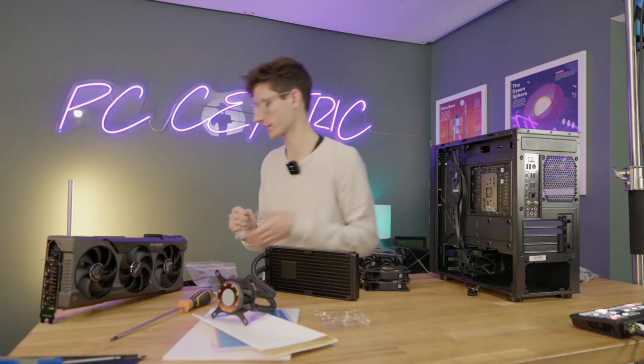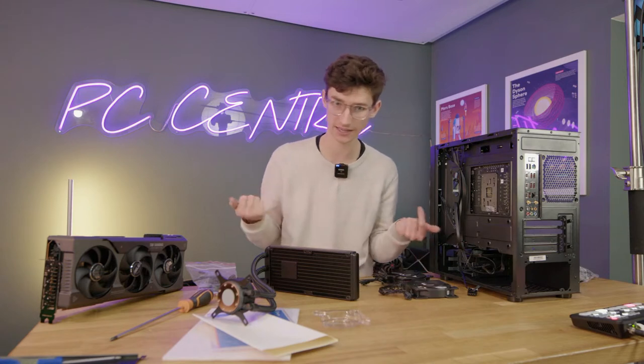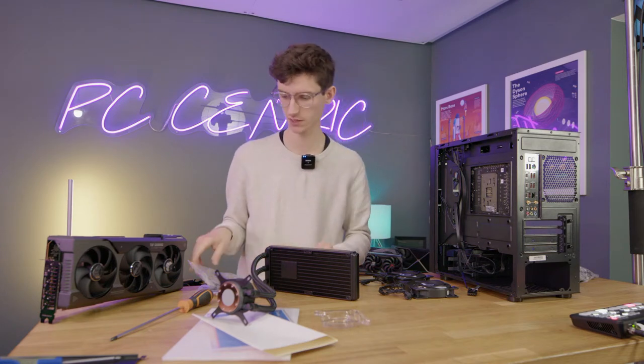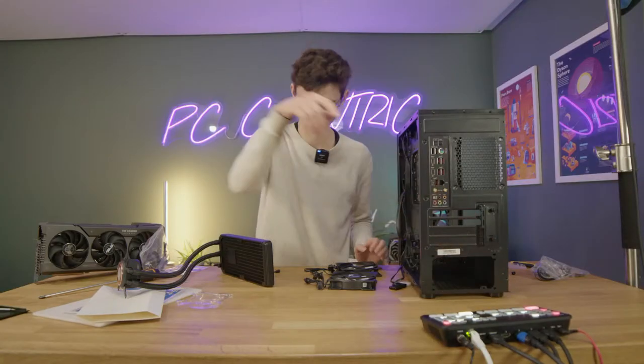I had an early access one of those. It was an H100i Elite Capellix, and it did that. Had to go back. I don't know if it's new or not, but yeah, that could be an overheating problem. So if you have a different heatsink, try putting that on and seeing if it fixes the issue. Make sure everything's plugged in, fan headers, all of that good stuff.